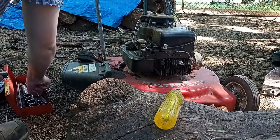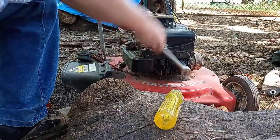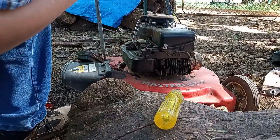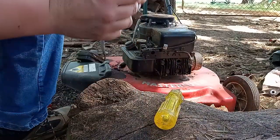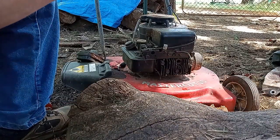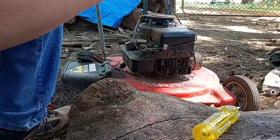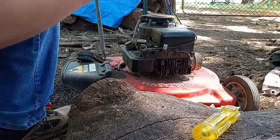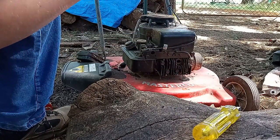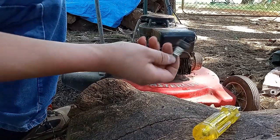This would be 3/4. Yeah, a little dirty. Looks like it's gapped close to about right. It's a CJ8. It's got the paint on it, so I'm sure it's probably the original plug. Probably never been changed. It's got black paint on it, I think. Looks like it. CJ8 would be the factory with the original. Yeah, it's got the little baby one.